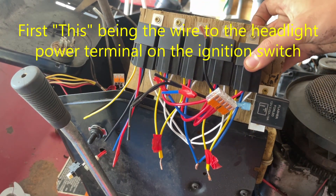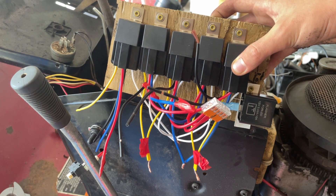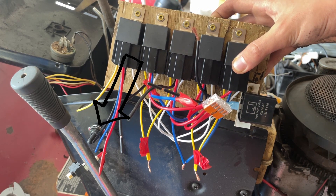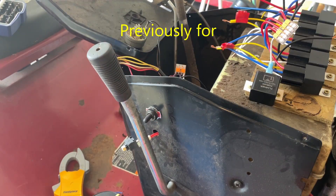This is the relay board. I'm going to put the schematic up right now of the changes I've made and what I've added. I already have a turn signal switch, which is just a single pole dual throw with an off position. That was for a 4-pin trailer light connector that I added. And now I'm going to add real turn signals that blink, real brake lights, better headlights, and taillights to the lawn tractor.